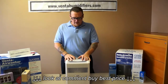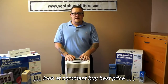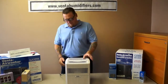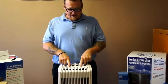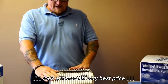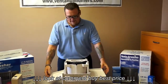We're going to take the motor out and run a test to see if it's operating correctly. Shut off the unit and unplug it from the wall. At the top of the upper housing there are two thumb tabs — depress those thumb tabs to unlock the top, and it opens up like a flower. First open up the grated side, then open up the solid side.